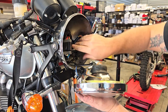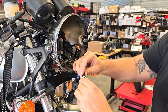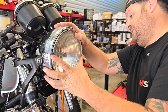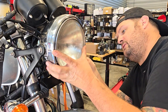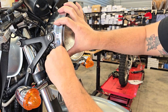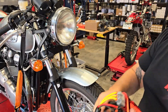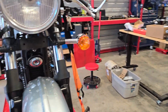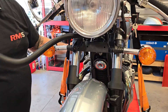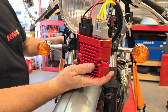We're not going to be using that old connector any longer, so I'll put the wire clamp back in place, plug the headlight back in, and hang the headlight back in place — it slides in up top, then you get your two Phillips screws, one on each side. I'll put them in loosely for now and tighten them up later. Now we want to mount our new regulator and harness. Since most of the vehicle wiring runs on the left side, I'm going to run the bypass system wiring on the right side of the bike.